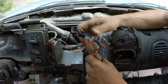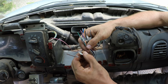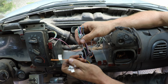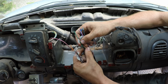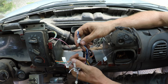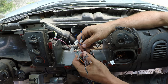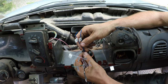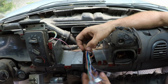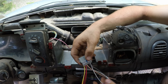There's a bunch of unused wires here. There's another four wires for speakers that aren't used. There's a few others — we've got key one, key two. I should look at the manual. Illumination. Parking — what is parking? There's the ground, I'm using that. Reverse lights — that's probably for the rear camera, which you don't really need because you can see really well out the back of this truck. Then we've got a power antenna, which I don't have, and an amplifier to turn on an auxiliary amplifier.